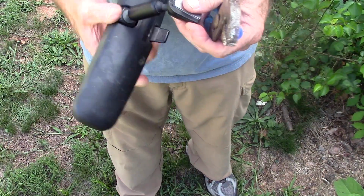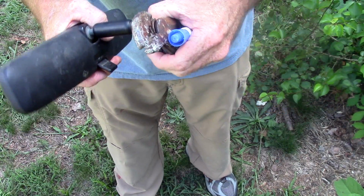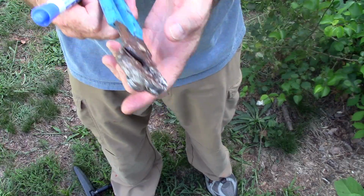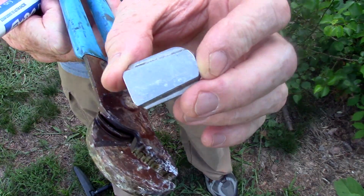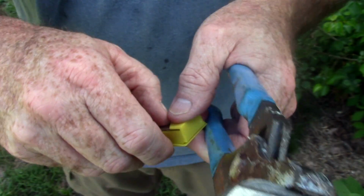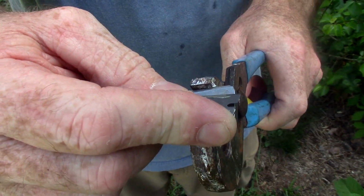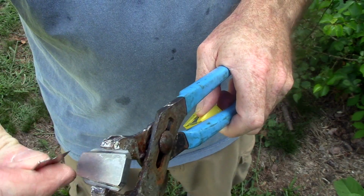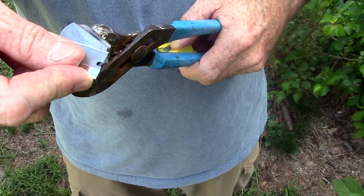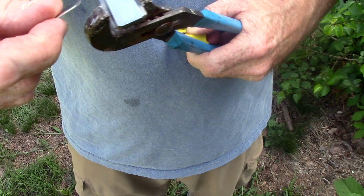Okay, I've got you down here in the shade now, so you can see a little better. Hopefully your little bracket is still clipped in, but that thing will just pop right out of there. This one's got a little spring clip on the back of it, and I've already, as I said, soaked it in the stripper, so most of the adhesive is off of it, but there's a little bit of adhesive right up on the back side of there. So just take a plain razor blade like this, basically a safety edge razor blade, and you can see it peeling up there. Just make sure that you've got this thing cleaned off completely. With the stripper or acetone or whatever, it shouldn't be too hard. If you've got a little bit left on there, just make sure it's all cleaned off. Don't cut yourself, because blood will probably interfere with the bonding process.